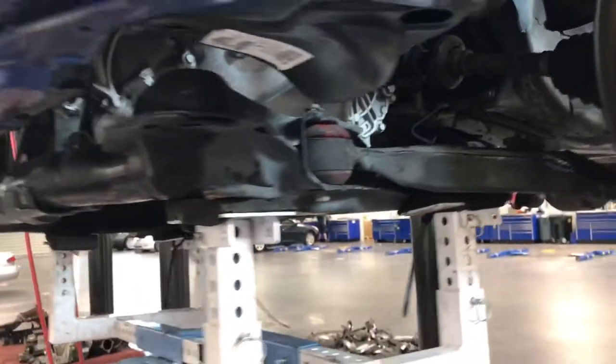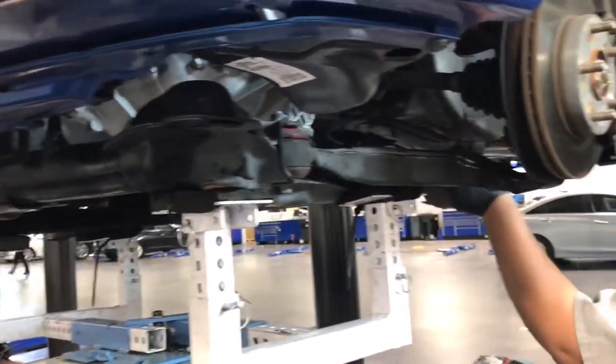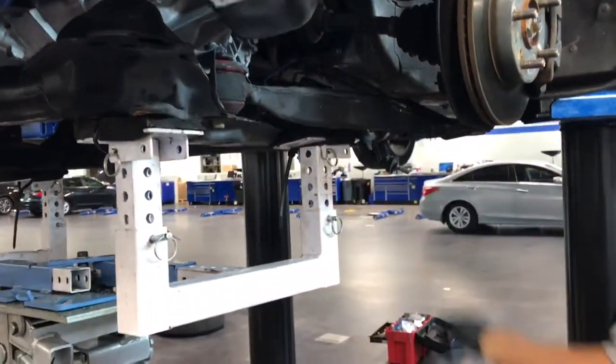It's got a mounting point up there, and this is on the very front of the car. Then the back and front motor mounts — and that should be all to drop the subframe on this car so you can easily get access to the bottom side.